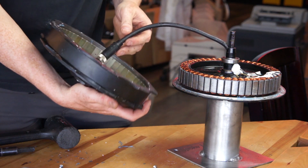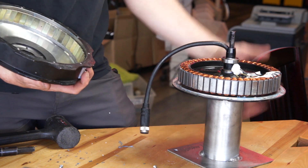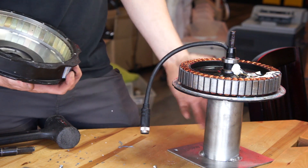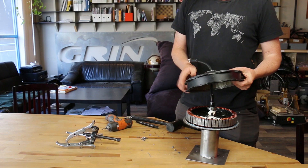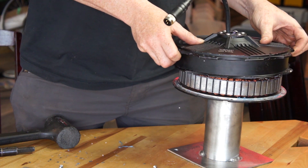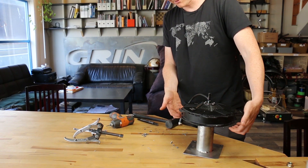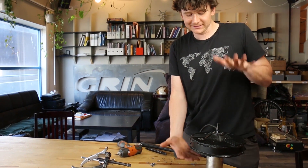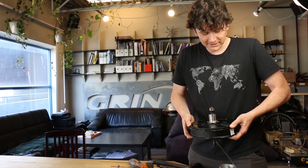For reinserting the stator into the shell, support the stator on something where it's free to move up and being held really nice and flat. Any random bucket or container that allows the axle to stick through the back end will serve this purpose quite well. Feed the cable through and hold the stator so it stays as parallel as possible to the axle when you feed it on — then it will just snatch down. Be careful not to have your fingers in between; hold it on the outer flange. The magnetic attraction will slam the two pieces together, but gentle enough not to cause any harm.